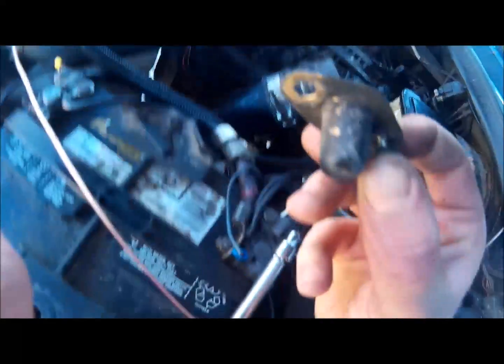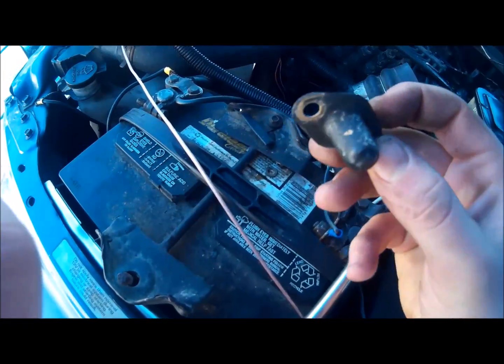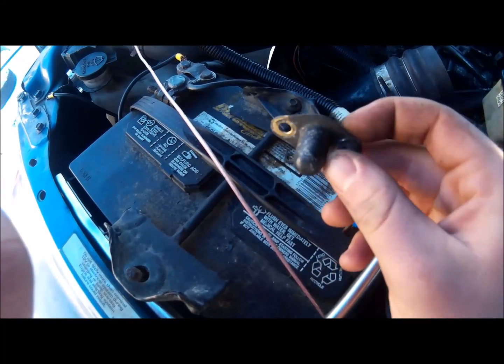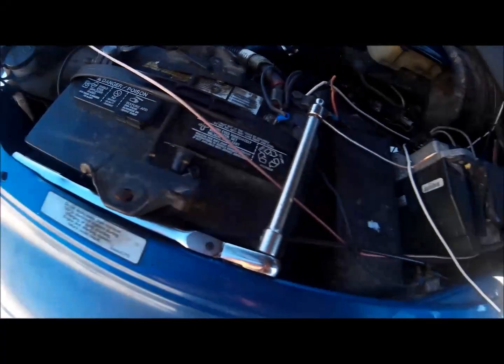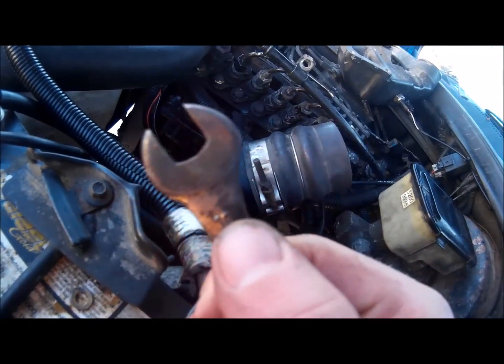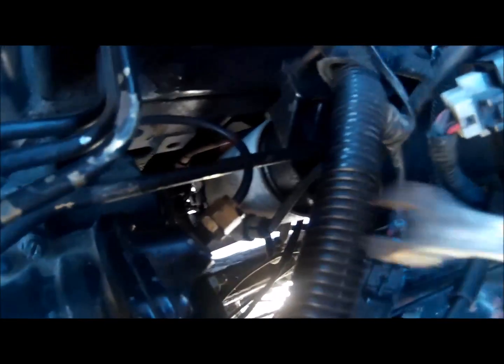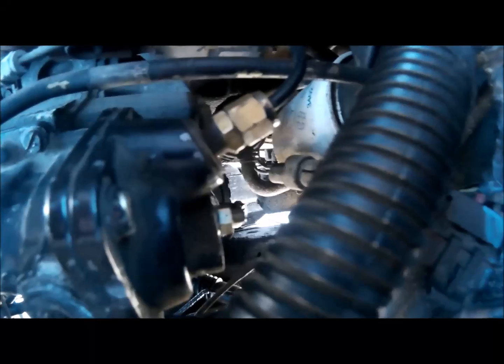This little guy here is going to be a protective cover that covers the smoke screw. You don't need it, although I'm going to put mine back on just to keep debris out of the smoke screw — if you don't put it on, it's not going to hurt anything. Let me grab my 10-millimeter wrench. I'll show you the smoke screw first — right on the back of the AFC housing, there's that little bolt and nut right there — that'll be your smoke screw.